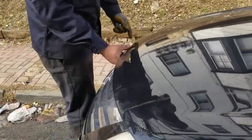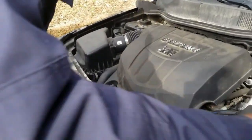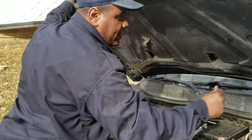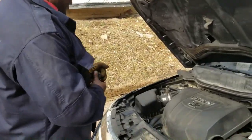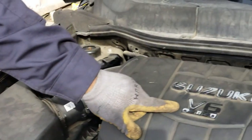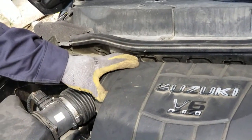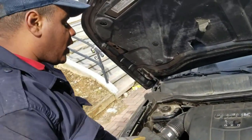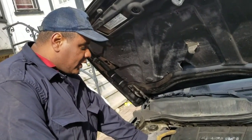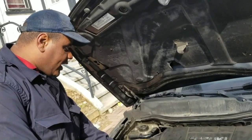Okay, we're going to go ahead in here. This thing's broken here, but let's find out what we can do. According to what I can read in the car and the sounds, this is a V6 3.6 engine in Suzuki. It's very common. This is a timing chain. This car has a lot of issues with jumping the timing and problems with the tensioner that holds the timing. So what I can read from now is that the car has no compression.